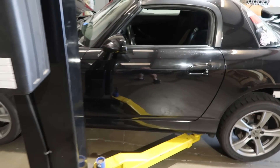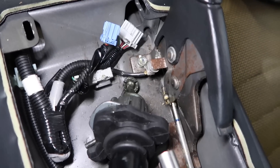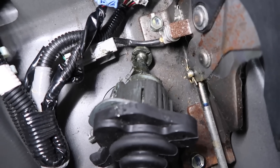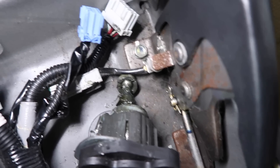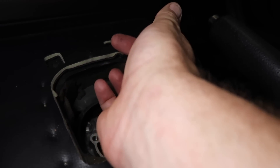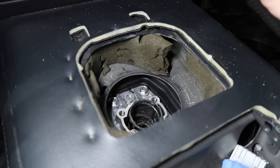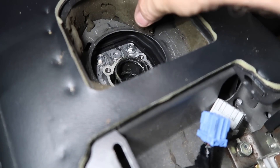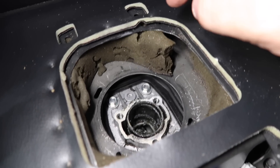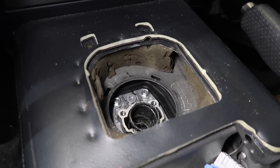Let's get the clutch out and show you what it looks like, because if it looks as bad as it feels, it's pretty darn rough. Just took the shifter out — it doesn't look too bad, going to clean and re-grease it. They mentioned they replaced these parts and might have damaged the shift while putting it in. We're showing you this foam isolator right here — its whole purpose is just to make the interior a little bit quieter, stop some of that transmission noise echoing through the car. And as you can see, it's falling apart. We're going to replace it with a nice new one.